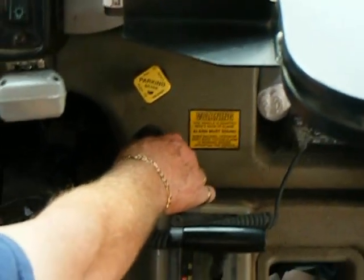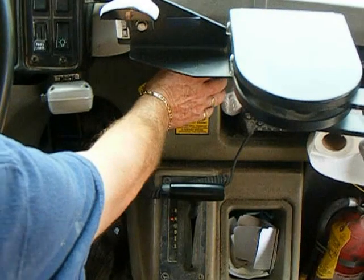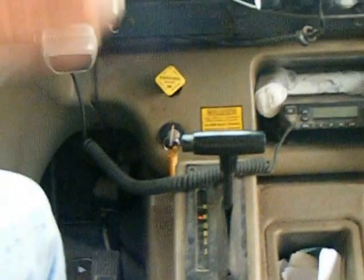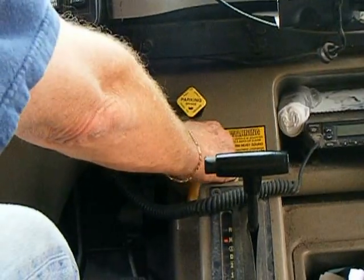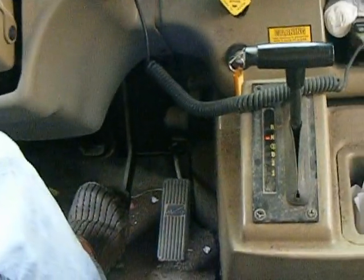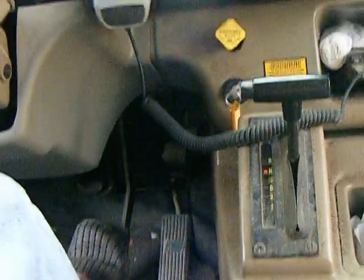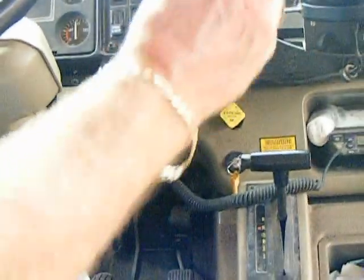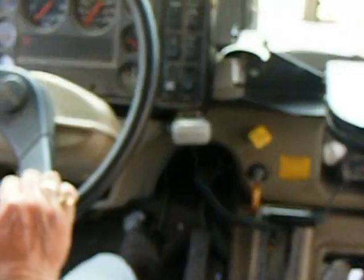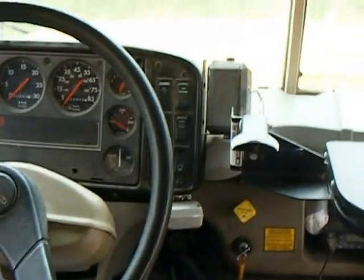At this time I'm going to shut the bus off. I'm going to release the brake. We'll chalk the wheels to make sure the bus doesn't move. Now I'm going to turn the key back on, step on the brake until it settles. I'm going to wait for one minute — no more than 2 PSI lost in one minute. Any more than that, the bus is not serviceable.